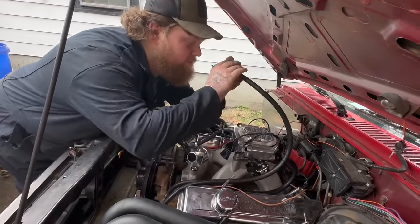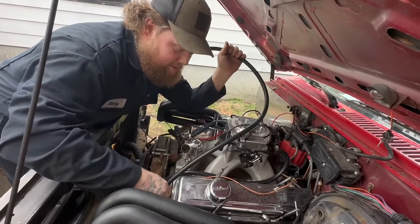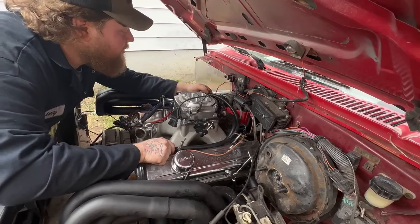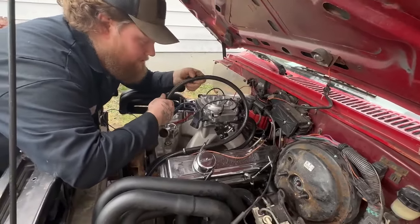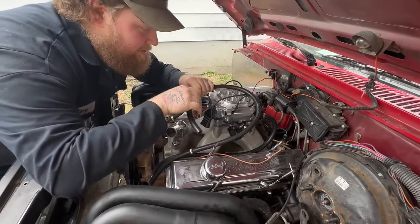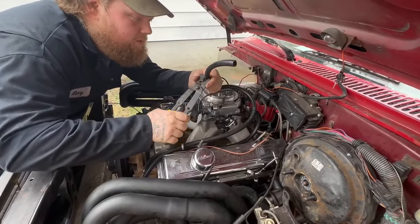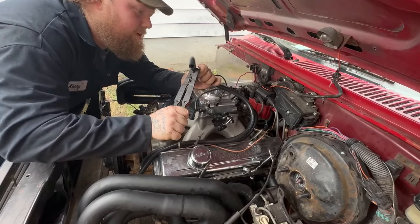So all you have to do is drive it at operating temperature, which is above 160 in the Sniper book. And once it reaches 160, your operating temp, the handheld switches to learning. It'll say it right on your handheld. And from that point forward, it is learning and self-programming to run your motor. It's changing fuel tables, and it's doing all kinds of different stuff.